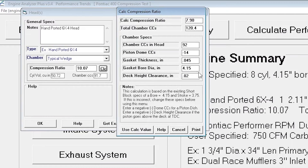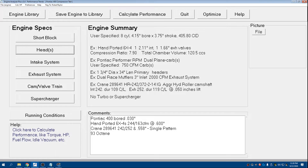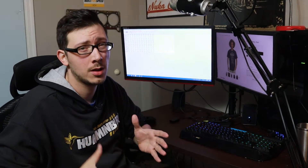Looking at the numbers, we're sitting at a 7.9 to 1 compression ratio — that is not great. We're going to use the old calc value and calculate performance. We see 411 horsepower at 5,500 RPM — that's not terrible. Looking at the spark advance, there's no risk of knock. This is running 93 octane with super low compression. Something to think about: you might actually be hurting your engine a little with higher octane if you don't need it. Generally, just run what octane your engine wants to run.